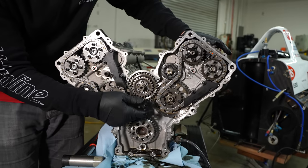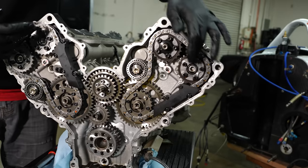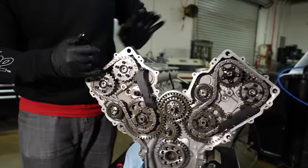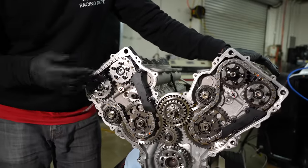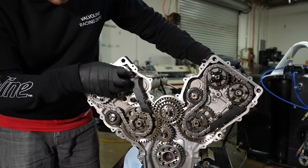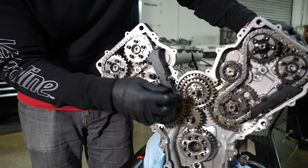That is sending timing — gear to gear to gear, and then to this chain, and then both sides here — these four are camshafts and they control all the valves: intake valve, exhaust valve, intake valve, exhaust valve. These are not variable valve timing — what timing is on the camshaft is what you get. You've got tensioners, extra pulleys, and all that sort of stuff. Everything is gear and chain driven, so you really don't have much variation in the timing.